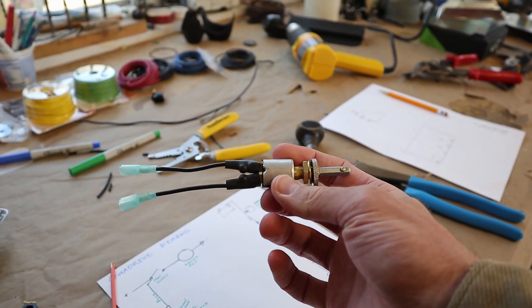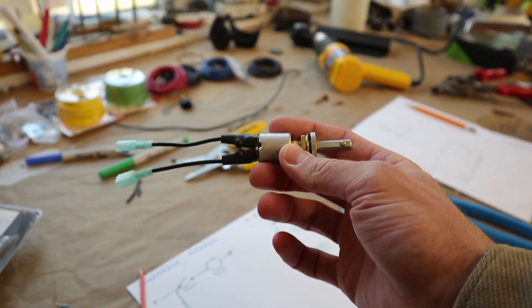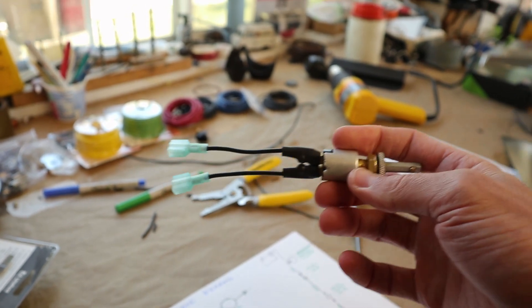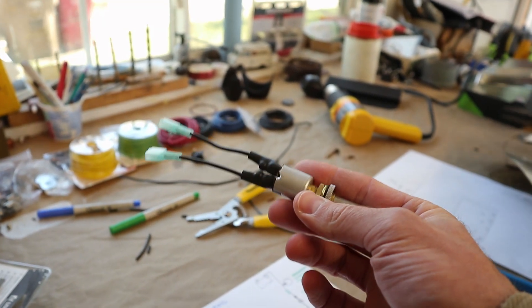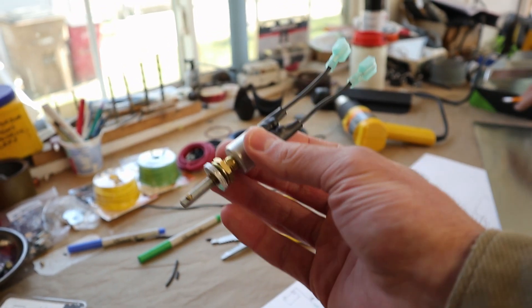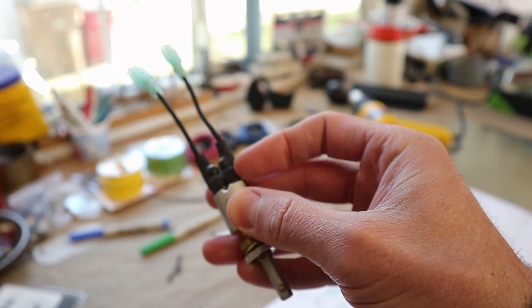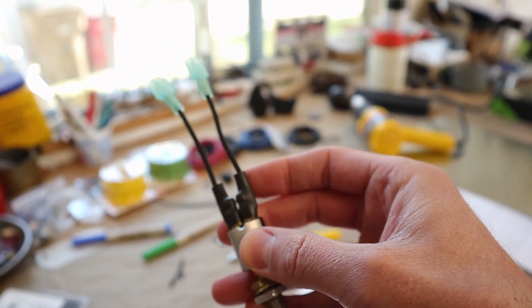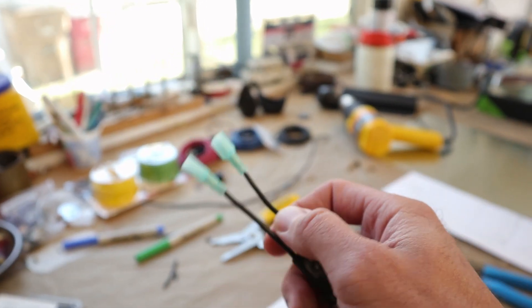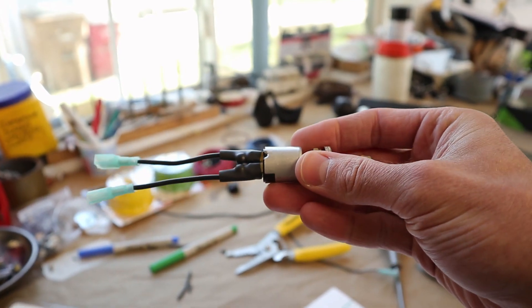This heater fan switch is where we're pulling the power off of. As we mentioned in a previous video, I don't really care for the design of this switch. In fact, I haven't ordered a new one — we actually repaired the one that I broke, and we're gonna run with that for a while while I try and find a better solution. What I've done is just put the wires in here and then covered these bare contacts with some heat shrink tubing, and tightened it down really well, so that hopefully we won't have any stray wires getting on there and causing any shorts.